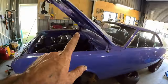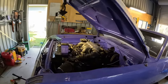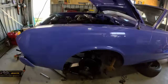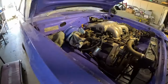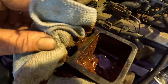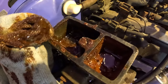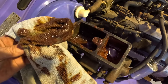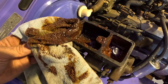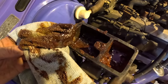Alright, we had some lunch and now we're on to bleeding the brakes. Jax is just outside sandblasting and painting the top of the reservoir cap — it was like crackly chrome. We're up to bleeding the brakes and you can see it's been sitting for quite a while — look at how dirty that fluid is in there. That is just delicious. So we've got to do a thorough clean out of the brake reservoir, probably flush the line, even blow it out with air to get everything through it. That's going to take the next half an hour.